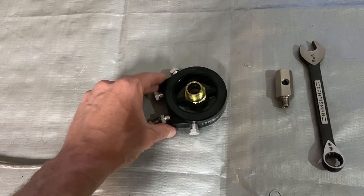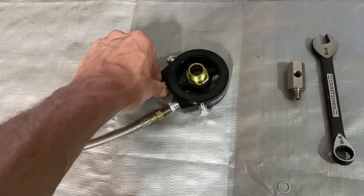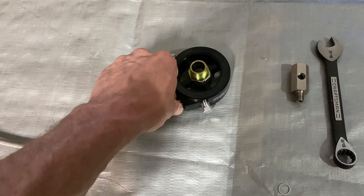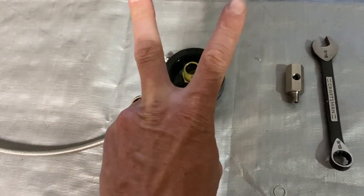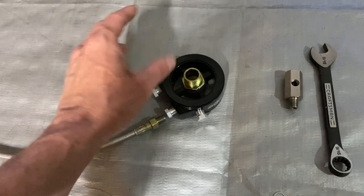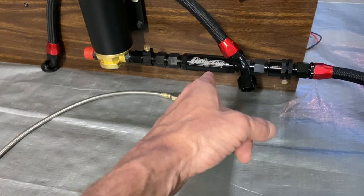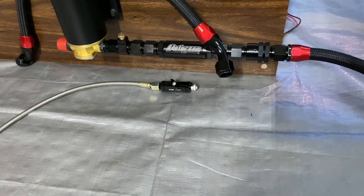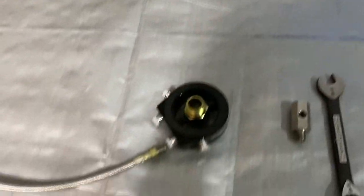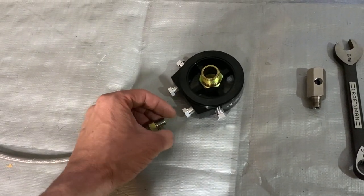Con, unfiltered oil going to your turbo. On this cheap $555 billet turbine turbo, I'm not really too worried about too much unfiltered oil. I shouldn't have any bad oil going to it. What I'm really worried about is unfiltered oil going back to the engine, and that's why I already have a filter in place for that. It is magnetic and catches particles and big chunks and whatnot. I'd rather save the engine than the turbo, right?